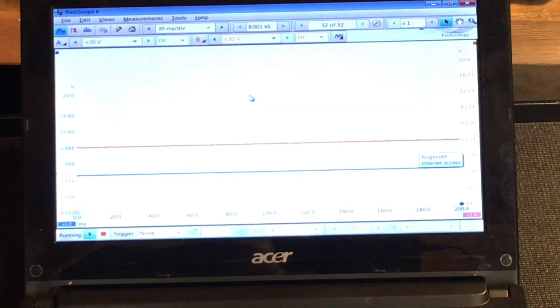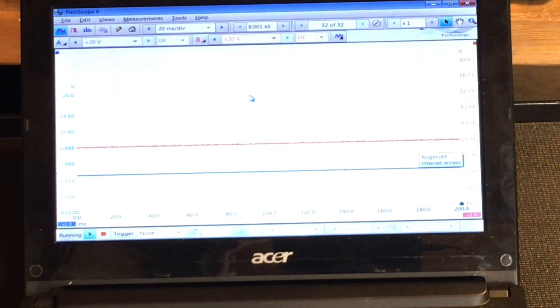I was hoping to do the AC ripple on the generator output, boys, and actually scope the current output as well. I'm going to save that for yet another installment, although I'll make it a completely different video series. I think this one will flog this dead horse for long enough. But this is interesting. I've actually learned something here, and the manual does not explain this. I think the ECU just puts a request in, and so long as the alternator is actually furnishing the current for that request, the request disappears from the ECU again. That's what it certainly seems like. So let me start the car again and we'll see what happens.